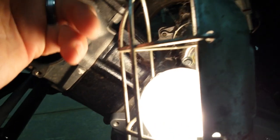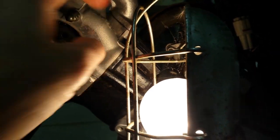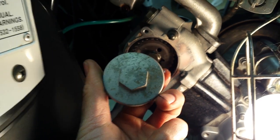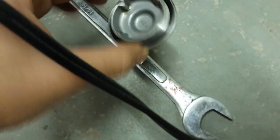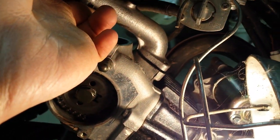One thing I had to do was take out the two screws in the intake to get enough room to get this cap off, which looks like this — it's a 24 millimeter. If you don't have a wrench that big to get into that tight spot, I used the 15/16ths. It was plenty tight on there, but I still couldn't get at it without breaking this loose and lifting the intake up slightly.